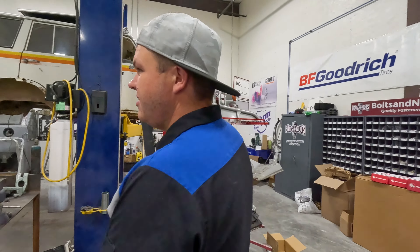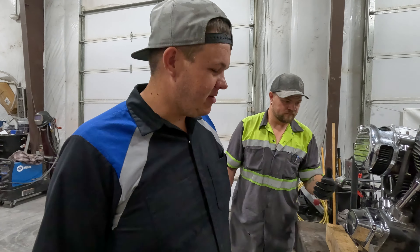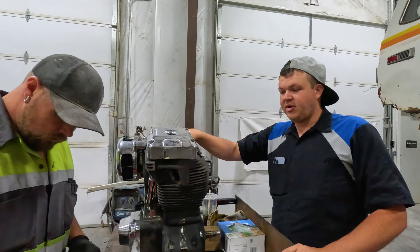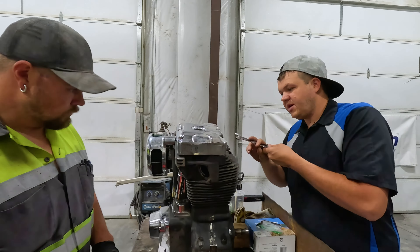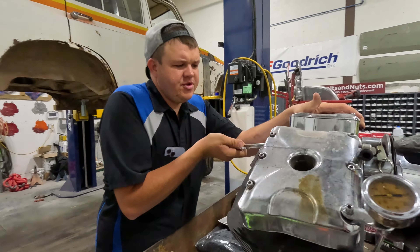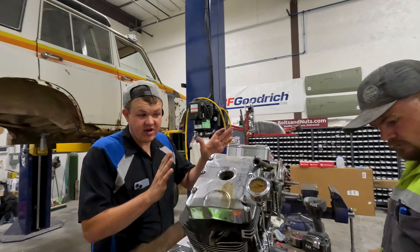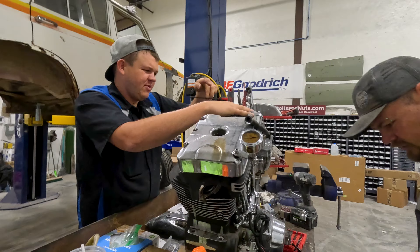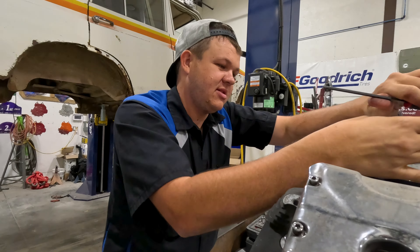Can we do silver with red candy over it? I think we need a bigger block. Maybe we should call Craig. We're going to FaceTime Craig from The Bearded Mechanic — our friend Craig. Him and Sean have another channel called The Bearded Mechanic and he's a bike mechanic. We're going to get the carburetor assembly off and then start disassembling this head, jug, push tubes, all that stuff to try to see if we can see down inside this case and figure out what exactly catastrophically failed. Taking the breather cover off because there's two bolts behind the breather cover that bolt to each head. We'll pull these four bolts and the whole assembly will come out with the intake and carburetor all at once. I feel like this is going to catastrophically fail. You remember when you were a child you would just take things apart just because it was cool and never actually put it back together.